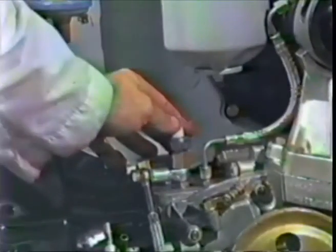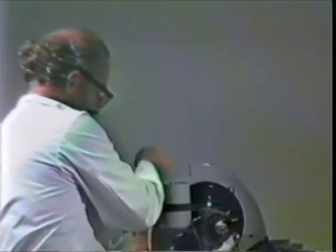This junction block and the gaskets thereon is the most likely spot for an oil leak to occur, second only to the oil filter can. So when you first fire the engine up, you have to check those areas for leaks. Okay, now we can attach everything to the filter can and get the filter tied down. So we put the oil inlet line here, screw it down just a little bit, get out our wrench we use to tighten the nut on the bracket that holds the oil filter can in place. And we'll get it snug, and then we'll adjust the height of the can so that the inlet line is proper.